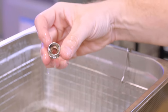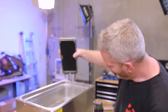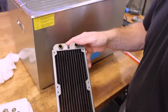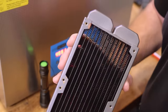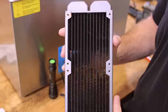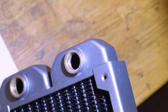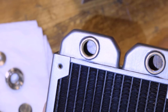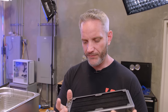So these were the really screwed-up ones — it looks better after multiple cleanings. What are we going to get out of the radiator? Oh yeah, look at all that crud — it's like milky. These are painted Primochill rads, painted by Primochill not me. The side the fans were mounted on you can see some of the paint flaked off with the ultrasonic. It's worth pointing out that if you have any chipping paint anywhere, the ultrasonic is going to work that loose. In terms of inside though, nothing really changed — the threads still have buildup, so we would still have to rely on chemical cleaning for the radiators. I just think the sonic energy isn't enough to get through in there.